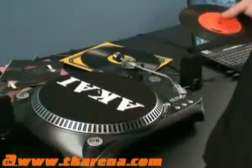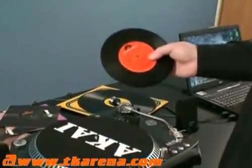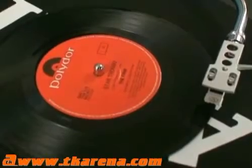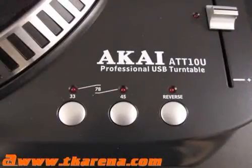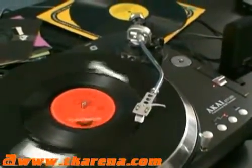I'm going to rip an LP into an MP3. I've found something very tragic — it's Star Trek by The Firm. This is actually a 45-speed record, so we'll hit our 45 button, start the turntable, and get ready to lower the needle. Our USB turntable comes with a free audio program called Audacity. This program allows you to interface with the USB connection and directly record your MP3 or audio files. Lower the needle — once you hear the music start, hit the record button.